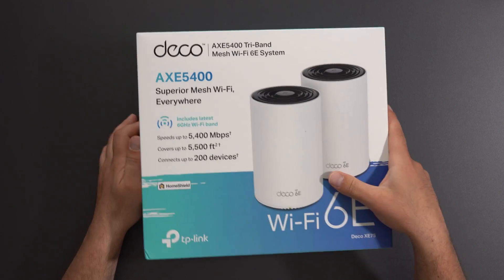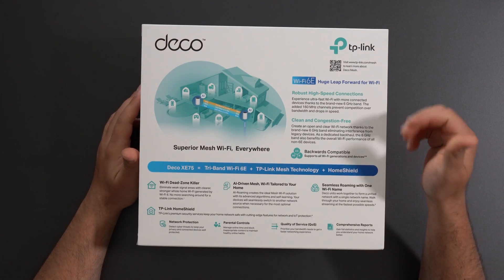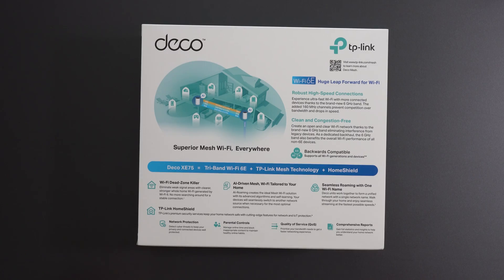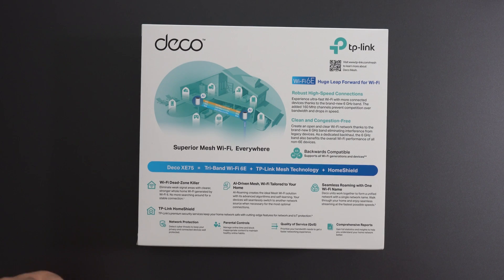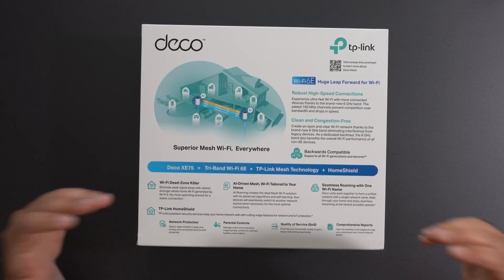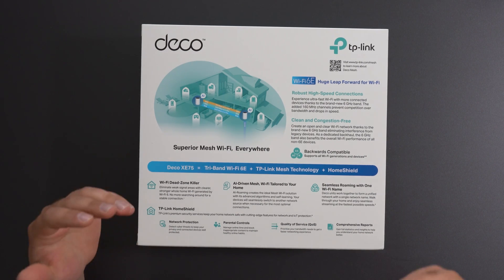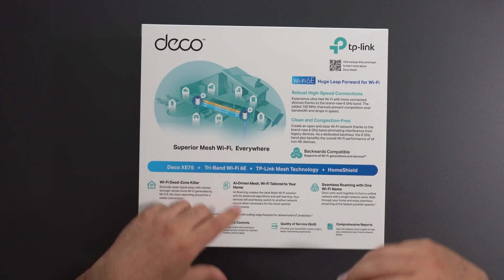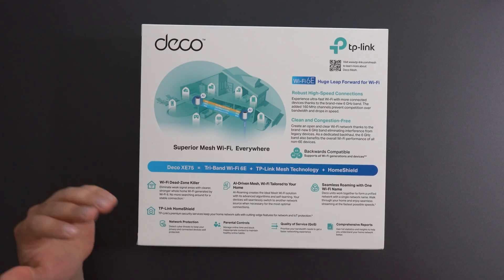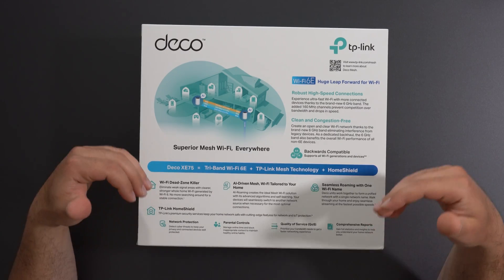Now what is Wi-Fi 6E and how does this make things better? Wi-Fi 6E in a nutshell is a new 6 gigahertz band that is a lot less congested, resulting in faster speeds. It also has 160 MHz channels, so it's supposed to be a faster frequency that you can hop on. Even if you don't have Wi-Fi 6E devices, there's still a benefit because they're going to use it as a dedicated backhaul channel, and because Wi-Fi 6E supports faster speeds, you can in theory get faster Wi-Fi connections in a wireless backhaul setting.